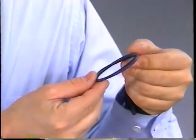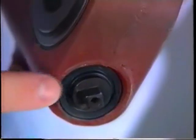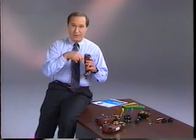Through the years, based on customer input, Rockwell has made a number of product enhancements to improve performance, quality, and durability of the automatic slack adjuster. They are new Teflon-coated and reduced squeeze O-rings to reduce internal torque, which provides easier mechanical operation of the slack. A new raised lip worm shaft seal with greater bearing contact to the worm improves sealing and prevents corrosion. For example, when the slack is mounted upside down, water cannot seep into the seal area.